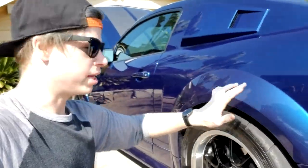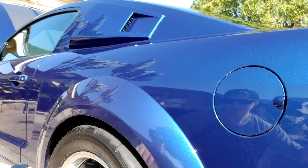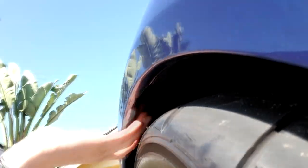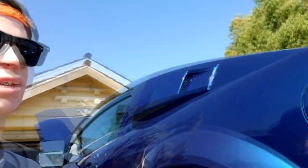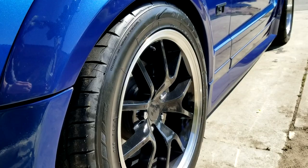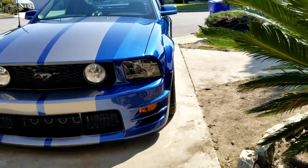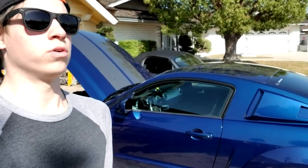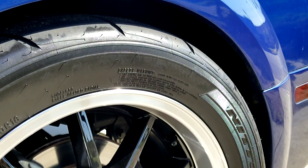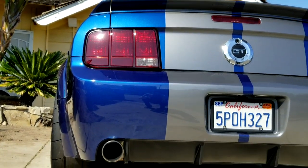I do have a little 3D carbon slightly wide body kit, kind of like the Dodge Demon look with the whole lip. I did have to go in there a little — I shaved away the metal from the original and some of the plastic from the body kit with a grinder. So it is possible, don't be afraid if you want fatter tires. Without the fenders I don't know if it would fit, but I got it to fit with no rubbing on the inside. I have the Tokico adjustable shocks, so I got the NT05Rs 315s in the back and 255s up front.